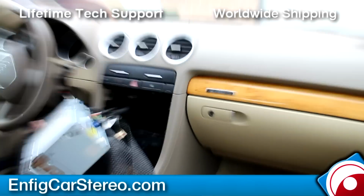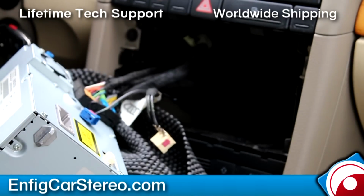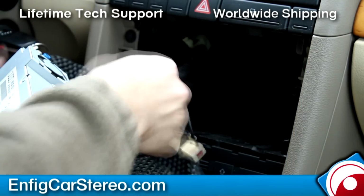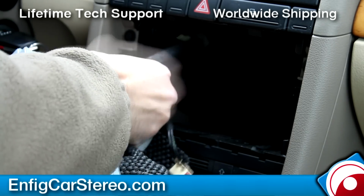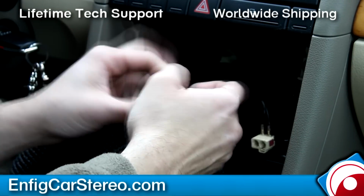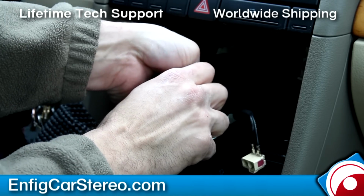Okay, let me try to zoom in right here. Where are we? Alright, you know what? I'm gonna unplug this radio. You guys at home, I don't recommend you do unless you have to. I'm only doing it to show you. 02 to 08 Audis, they remember the radio they were plugged into, so you don't have to worry about needing a radio code. But just in case your radio was replaced, try not to.